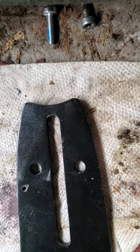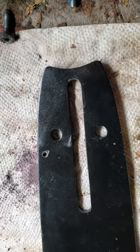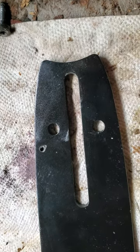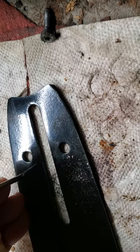Then I'll punch the drill through it — light pressure, very light pressure — and it'll fall right through there. When I'm done, take the chamfer bit back to it and just deburr the hole. You end up with something like this, which is a 5/32nds hole.